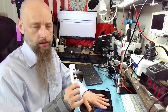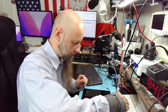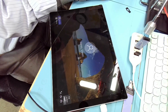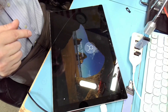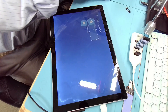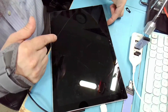I'm using the broken digitizer screen, so I also need a keyboard with a mouse to operate it, plus a USB stick with Windows on it. Since we can't log in, normally you would hold down Shift and hit Restart. It will present a recovery screen, and from there you select 'Use a device' and 'USB storage device.' Sometimes pressing the volume down button while booting will also cause it to boot from the USB stick.